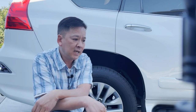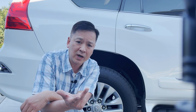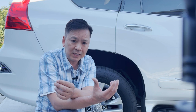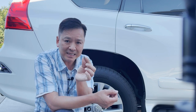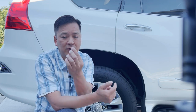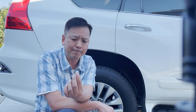Every weekend I went through a car wash, I go through rivers, I've been to the ocean, I backed my tires into the water to launch my boat, and my car has gone through rain. One of the big accelerators of galvanic corrosion is water itself. Over the months leading up to a year, my aluminum caps seized onto my valve stem threads, and to replace them they had to break my TPMS sensor — costing over a hundred bucks.